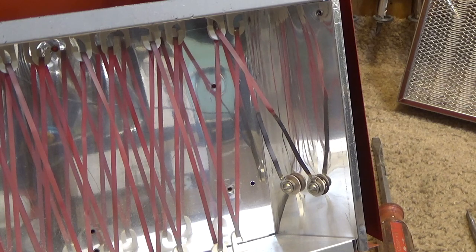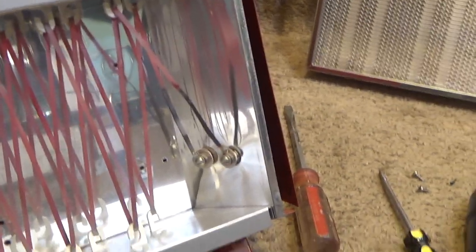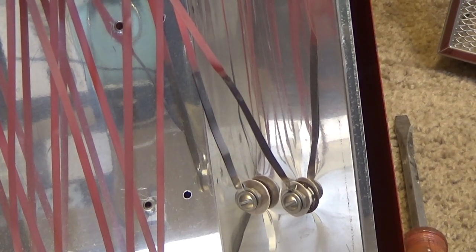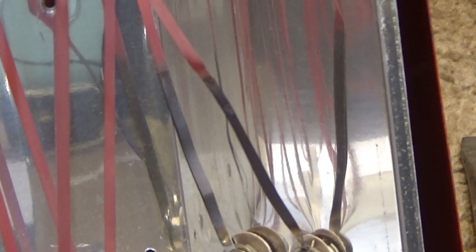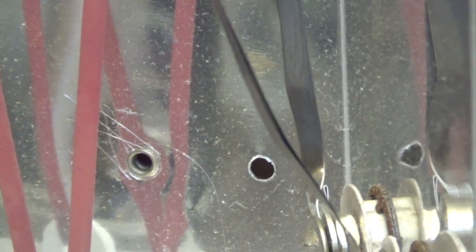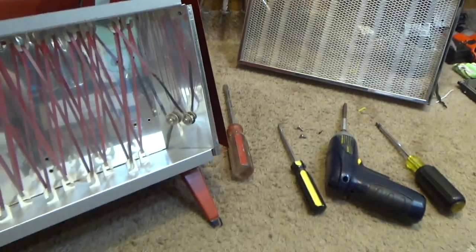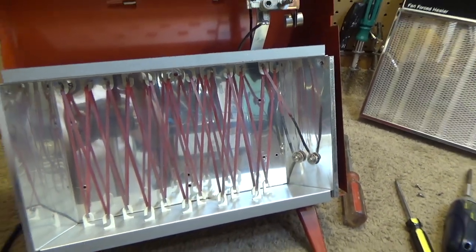And it's not working properly over there. Well, actually, I shouldn't just say that. It is folded twice on itself at the initial bend there. I don't know if you can see it from this angle. It's kind of hard to tell, but you can see right there. See, it's twice thickness right at the beginning, and then it lessens to just one piece right there. So that's why it's not glowing right at the beginning. But those two elements are staying far away from each other.